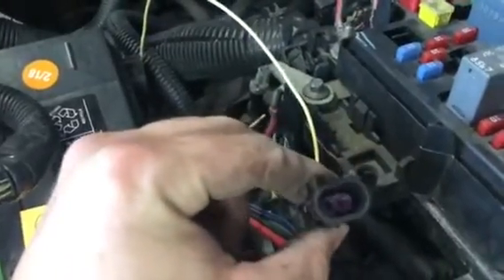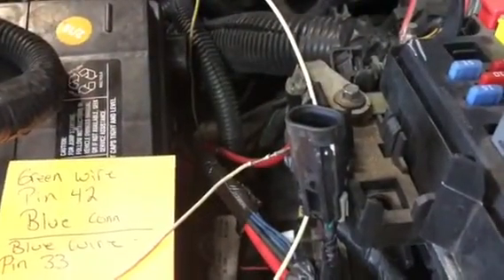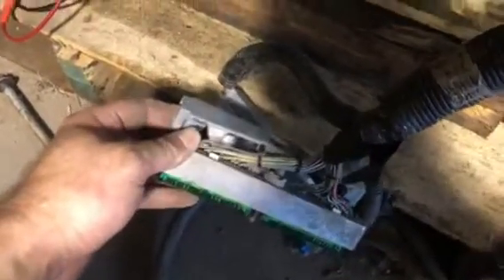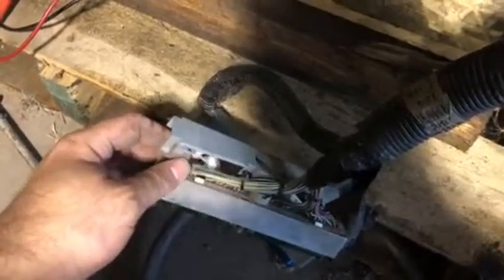What you also may want to do is go to the PCM and pull out the extra wire. There's a plug right here — it's a blue and green wire with a two-hole connector on it. You might want to go back to the actual ECM side of the harness and pull that out as well, which I can actually show you. If you come over here, we've got another harness and the plug you're looking for is going to be right there. You can just de-loom this and then go pull it out of the actual connector itself, and be able to plug and play it completely without having to add any wires.